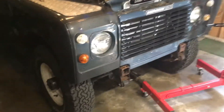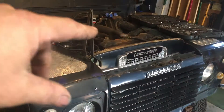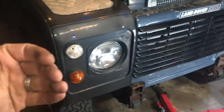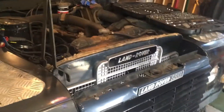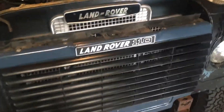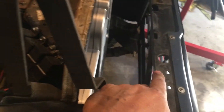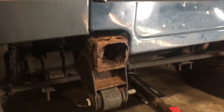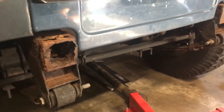What we're going to do is fit a 300 TDI in behind the front grille panel. The radiator bulkhead is very doable, especially in a Series 3 because you don't have the headlights in the way. We essentially want to fit all of this equipment up into this truck. We had a Land Rover 110 from the 80s making some donations while we work on a hybrid project. I put the grill in, got the slam panel in place, and I can tell I'm going to have to weld in a new cross member. The frame has some rust up front, but I can repair it.